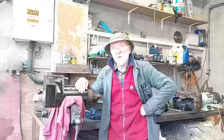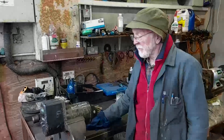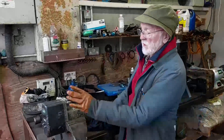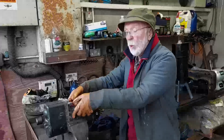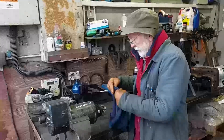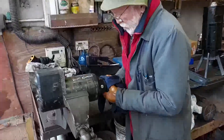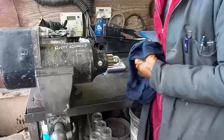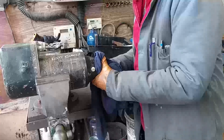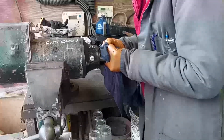Before I do that, let's just quickly go back and take a look again at the CAV starter and see how it works. On the traditional CAV starter, the whole rotor moves out in order for the starter to engage. Let me illustrate again. The whole rotor has to move out and in order to do that it has to overcome a really quite strong spring.